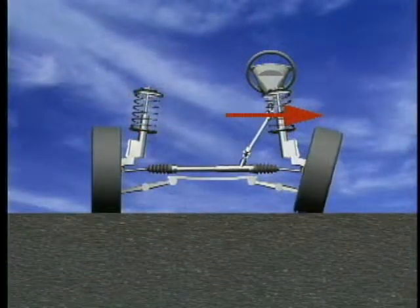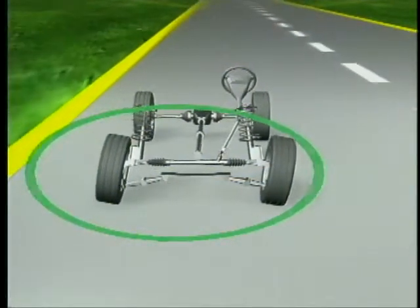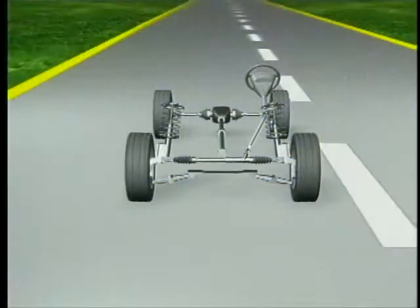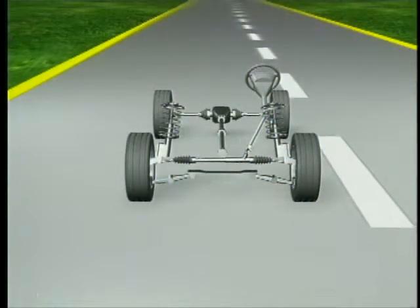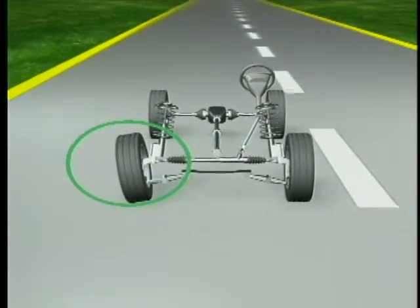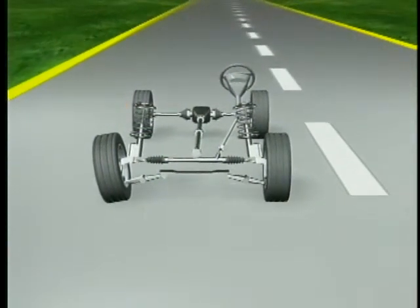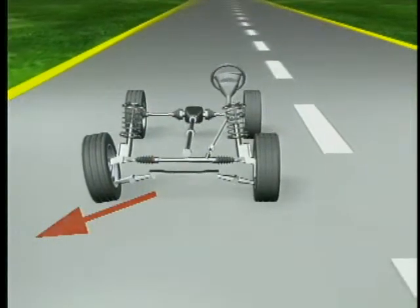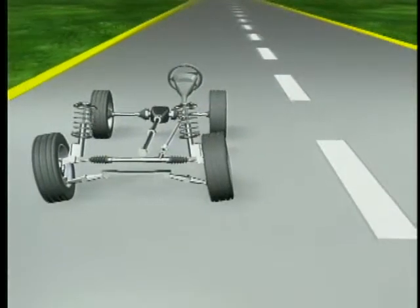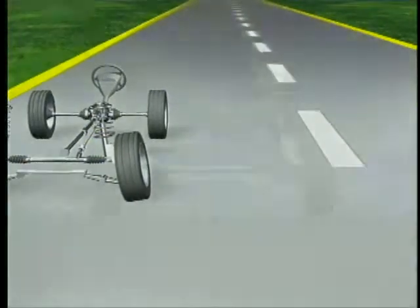Large side-to-side differences in front camber can create steering forces that may lead to a pull and cause accelerated tire wear. With the zero camber setting, steering forces are generated from either side, and each wheel rolls straight ahead. But if one wheel is cambered positive on the right side, it tends to roll to the right. Combine this with a left wheel that is negatively cambered, and it generates an even greater steering force that causes the vehicle to move immediately to the right.